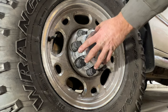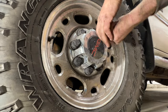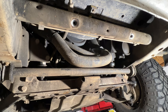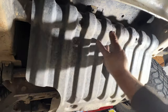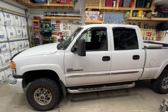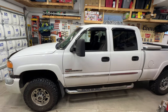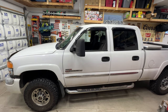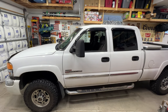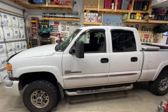Grab your center cap — I like to do these by hand so I don't break them. Lastly, grab your skid plate and get that back in place. That's going to do it for the video. This was a 2004 GMC Sierra 2500 — went ahead and replaced both lower ball joints. Hopefully this video helps you out. If it does, subscribe to the channel, check out my other videos on this truck, and I'll see you in the next one.